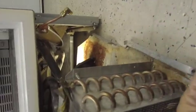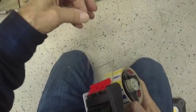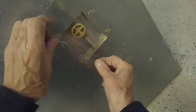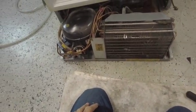and you hook up your, there's a little, like that. Okay, once you get that water valve situated there in that slot, you take this nut and get in there and put a screw in there to hold it in place. Okay, so we're going to add a little finishing touch here and put some tape. Keep the dust and dirt out of there. All right, that's it. Okay, so to reinstall the condensing unit,